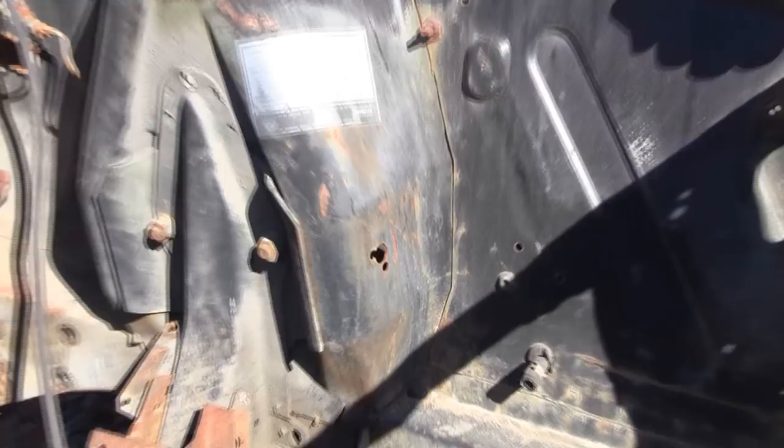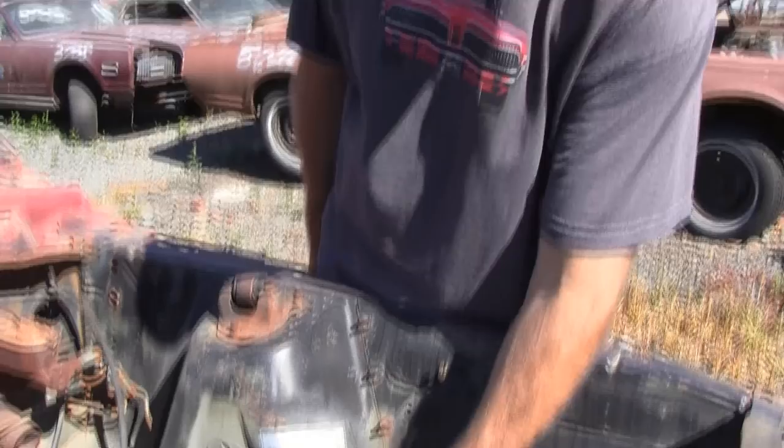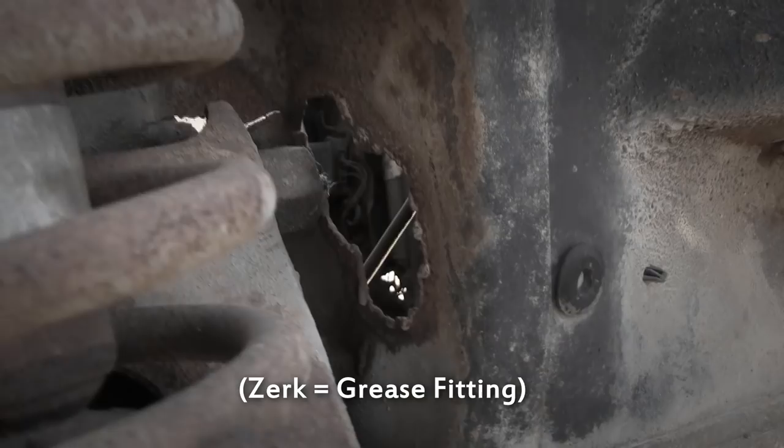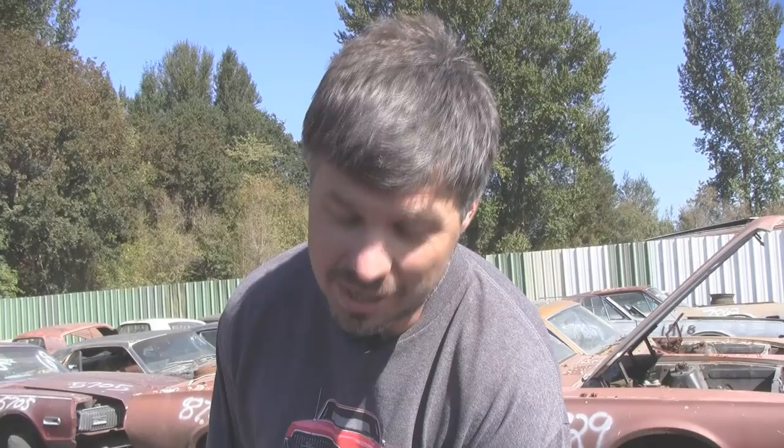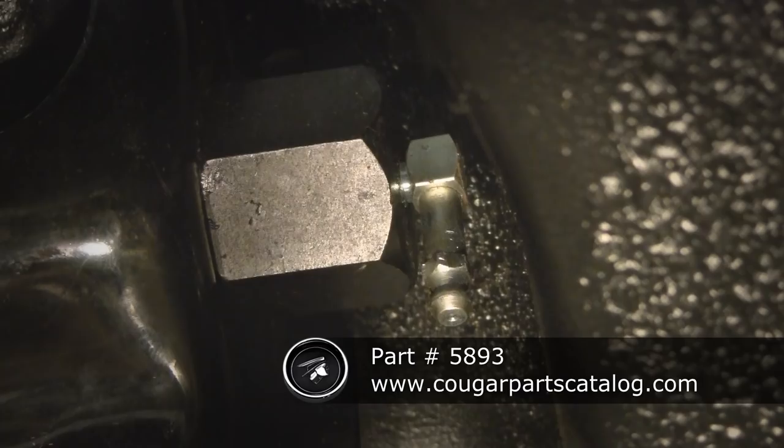Here's something you really ought to look at. A lot of people in the past have taken a torch, or in this case a drill, and drilled a hole so they can get to their Zerks — their upper control arms were squeaking, their shafts were squeaking. So don't ever do that to your shock towers. And if it has been done, it's time to fix it before you get cracks right here. We have a 90-degree Zerk fitting kit you can install with the control arms in place that allows you to grease from the inside. Big faux pas there.